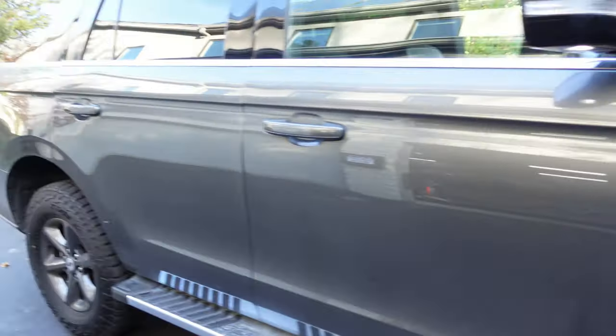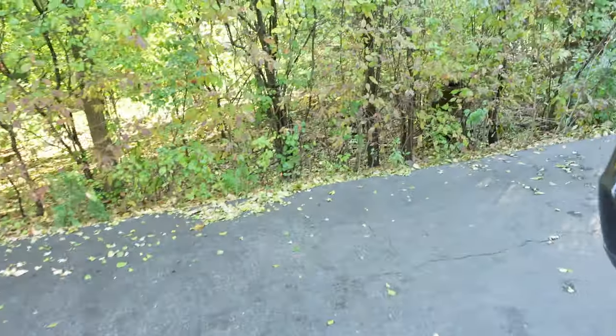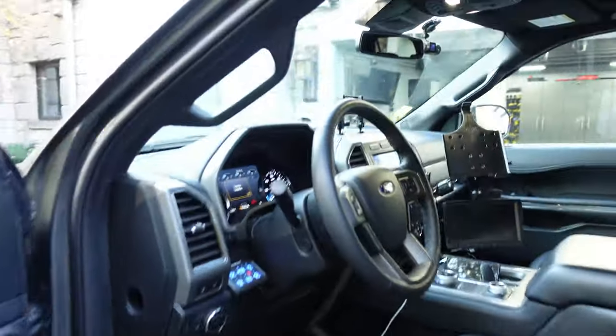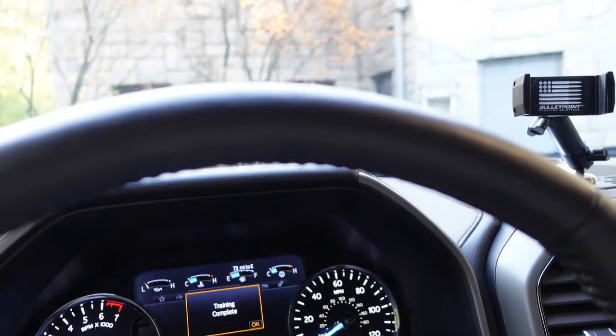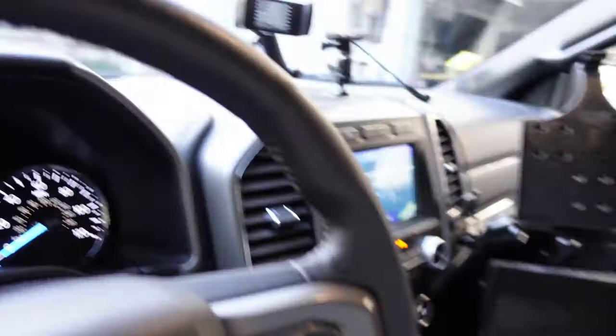Now, we know it's going to want this tire because you're working clockwise. And now let's do the last tire and then we'll see what it says. It says 'training complete.' Let's go enter, enter, enter. Those are the pressures. Now you're going to want to pump up your tires to whatever your desired PSI is, or whatever it says in the manual depending on what Ford you have. I'm going to pump mine up to 65 in the rear and 55 up front.